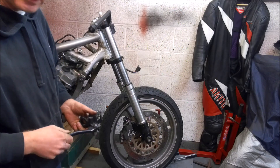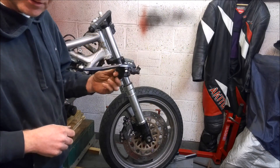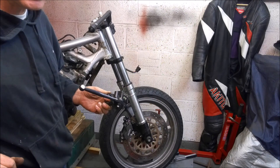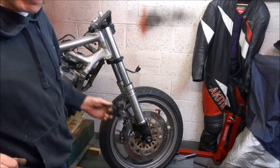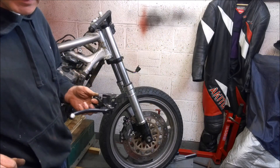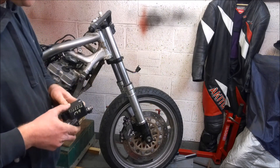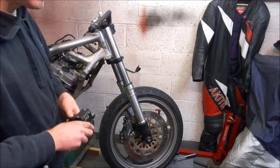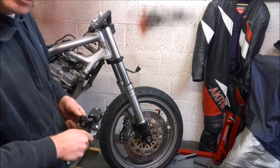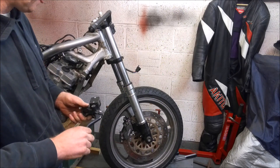We've sorted out the actual caliper we're going to use, and now what I need to sort out is what master cylinder I'm going to use. I've got this nice little unit here that's off a CBR125. It may seem like a bit of a strange step going from using the master cylinder off a 400 to one off a little 125, whilst putting a bigger four-pot caliper on. The logic behind it is this: the CB1 front master cylinder only has an 11mm bore, which kind of just about works on the standard sliding two-pot caliper. It's quite nice on the road, gives you plenty of feel without being too harsh.